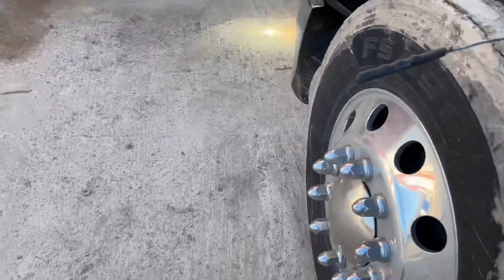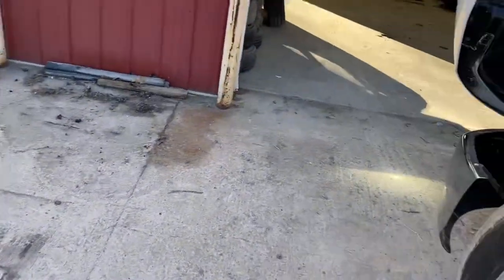As you can see, this is warming up — nice sharp lines there, real bright hot spot. That's low beam. And let's do high beam — there goes high beam. Still got the halogen high beam there. Now of course that's a bi-xenon so it opens up a little shutter and allows the bulb 100 percent of the reflection. So high beam and low beam.